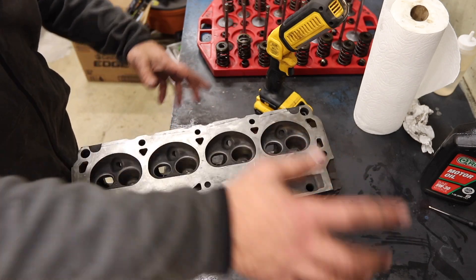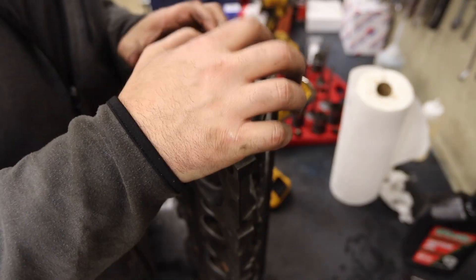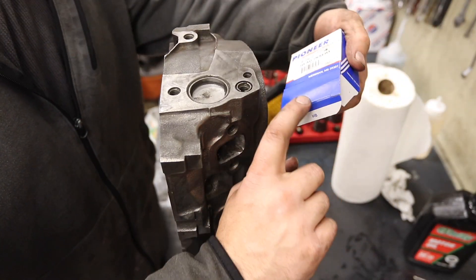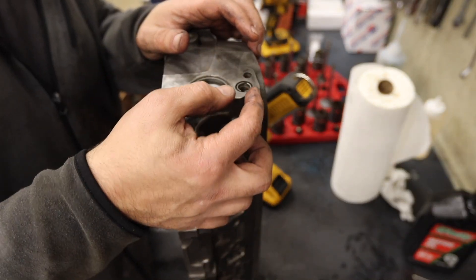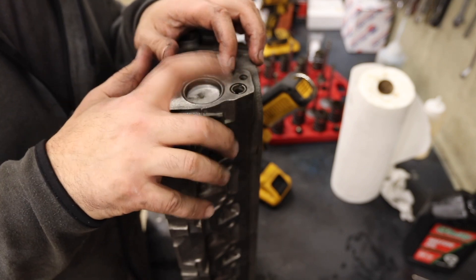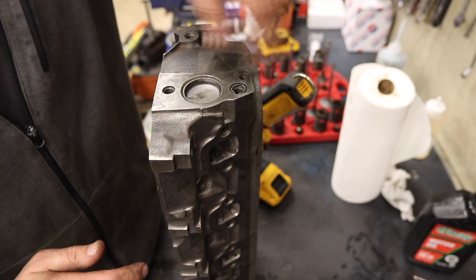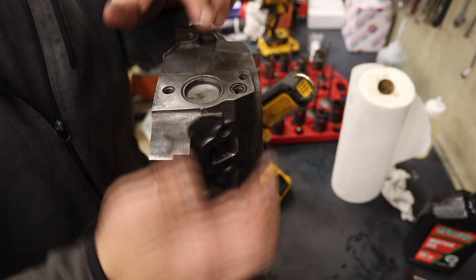All right, these valves are all lapped. I started with the passenger side and this is the driver's side — that's done. If you've got a 302 with a non-GT40 head, it'll have a smog port in the back and a plug in the front, and you've got to buy these head inserts — this is PF580-4, comes as a pair and you only need two. When you pull out the smog pump and go to put this in, you'll think it's not the right thread — what's actually happening is it's packed full of carbon. You have to take a pick and work at the carbon, get a wire brush in there, then use a tap — it won't cut new threads, it just cuts the carbon out. Then work it in with some thread sealer. One seats deeper than the other, depending on which side of the head you're on.